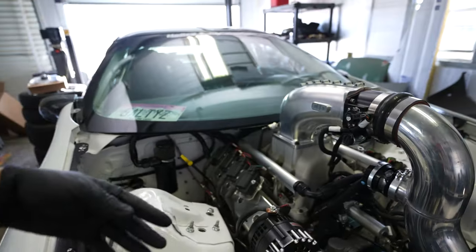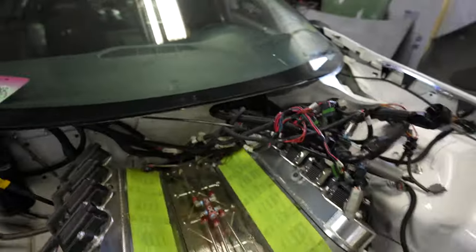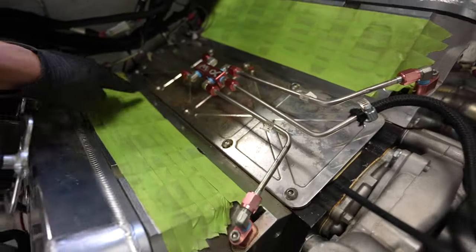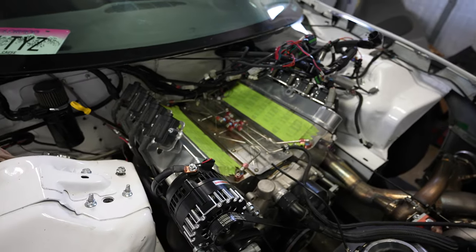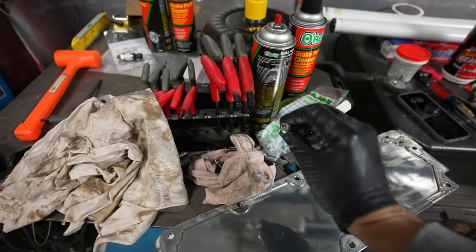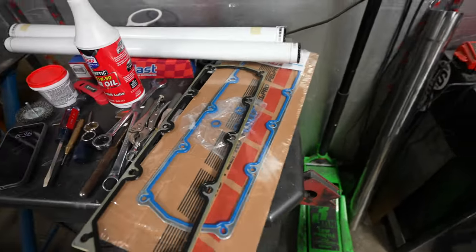It's making the engine bay a mess — goes back to the firewall, drains down, leaves drips, makes the underside of the car a mess. Just a little bit of maintenance before we get started with the season. Run all your wires underneath the intake, they said — well, it's a big old mess when you go to do it. But I left everything taped off so nothing would fall down in the cylinders. You guys can see all the oil. I think some of it's the sensor not sealing, and some of it looks like it could be coming from right here where it piles up. So I'm going to get that valley cover off, get some new bolts. It was a brand new seal, but maybe replace it — we'll see how it looks. Out with the old crappy Allen bolts that I wanted to strip and couldn't get torqued down, and in with these nice new flange bolts. I picked up a new gasket at O'Reilly — this one looks fine, but we've come this far, might as well put a new gasket in it.